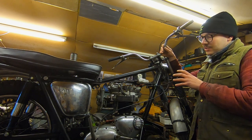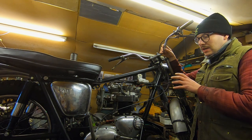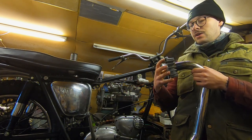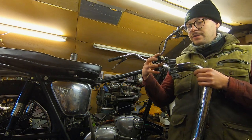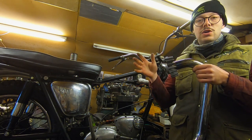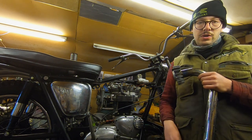That's our basic electrical system mocked up. I'm going to be going back in and refining this — I've got to order a couple of new bits — but for the sake of a test fire I think we're going to be good. Exhaust-wise, I've decided to go with these full bore TT pipes. They're a larger bore than standard unless of course you bought the TT model, in which case it would come with these from the factory. I've gone for the big thin exhaust clamps as well. A lot of people don't like these but with the larger bore pipe I think they're quite fitting. Following along with the States look I want on this bike, I think they're a nice part to use. I want to make some sort of bracket to retain them at the bottom, but for the sake of a test fire this will do.